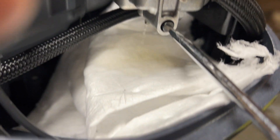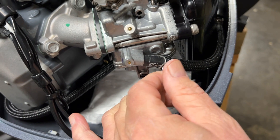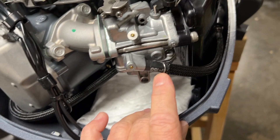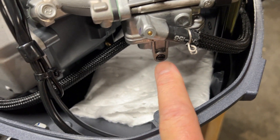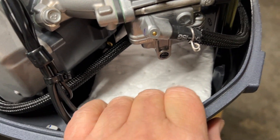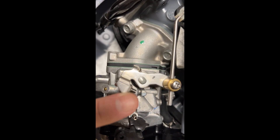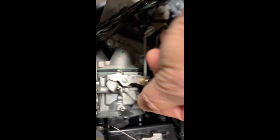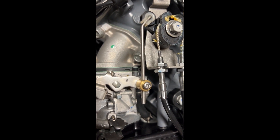You can see the fuel coming out. I'm taking out the first spring hose clamp — when they're off you can move them. There's always a little ridge that helps the hose seal, and you can squeeze these clamps tight and get them over that ridge and out of the way. I shut the fuel drain valve, all that fuel absorbed in the top layer of the absorbent material. I like to note the spacing and relative position of the rubber thimble so we know exactly where it goes back on.